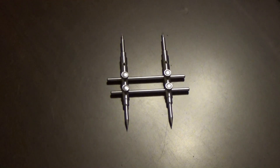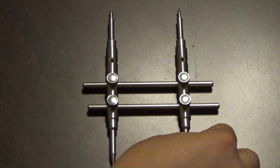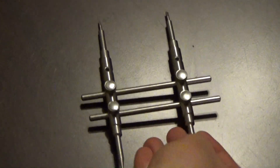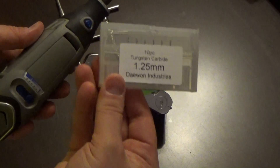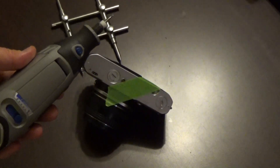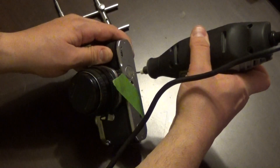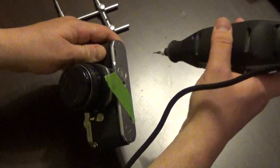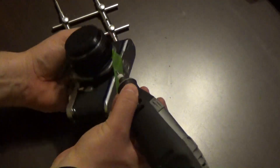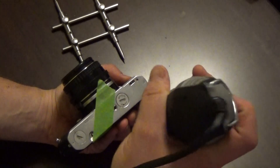You want to make sure that the one you get has two pointy ends on it, not just the kind with the flat head screwdriver ends. You need the points for this. So when you have your camera, your drill, your eye protection on, and your ear protection in, you're going to drill two small holes like this. You need them not to be on the very edge, but also a little bit far away from the center, because most spanner wrenches are not going to reach super close to the center together. You also want to have a little bit of good leverage.